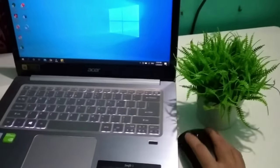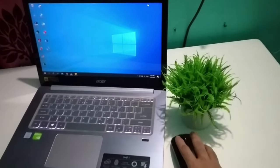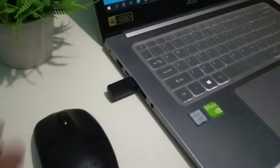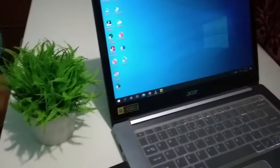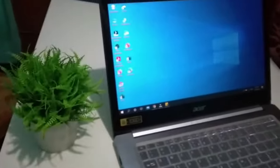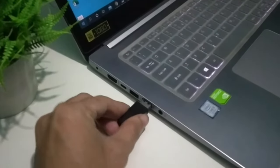After checking, you can see it's again not working. So what should you do? Follow the next step: check your mouse receiver. Just plug out and then plug back in your mouse receiver, then check your mouse. If it's still not working, plug out the receiver again, replace it to another USB port, and check your mouse pointer.